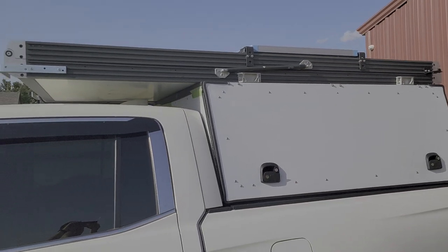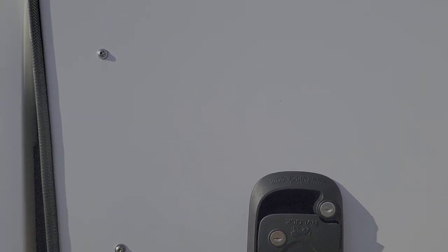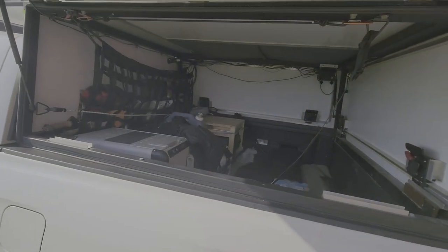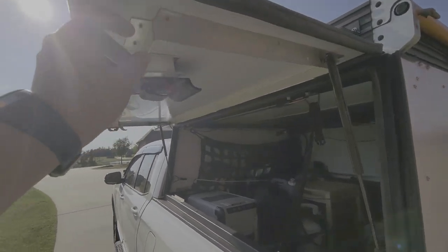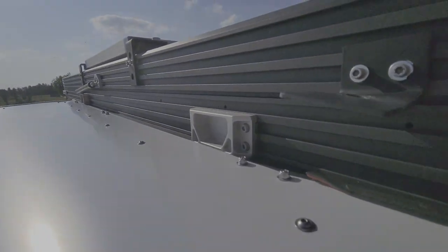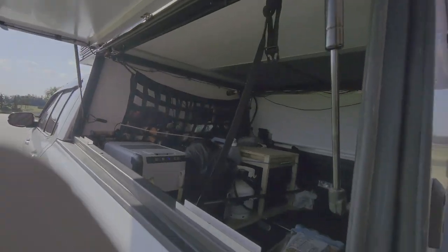This is probably the biggest question I get asked — my DIY camper. It's a GFC rooftop tent that I butchered and made into a camper design. When I custom made this, I used RV lock door handles because it allowed me to lock and unlock from the inside if I wanted to. These are aluminum composite panels — I just called a local plexiglass place and they were able to get them for me. This is pretty much following Ripcords on Tacoma World. The design uses inch-and-a-half square tubing, and over here I did an inch-and-a-half by three inch so I can mount the GFC using the stock brackets. These are for the latches so they can latch on, but I can open it on the inside and lock them if I want to — makes me feel a little bit more secure.